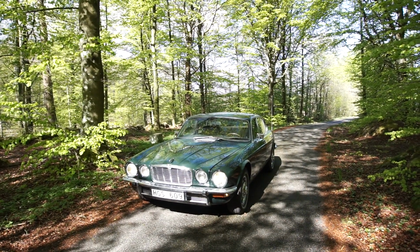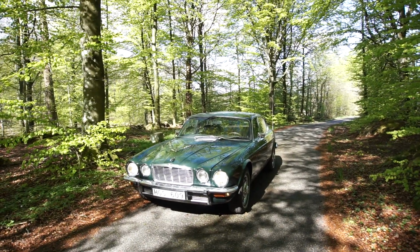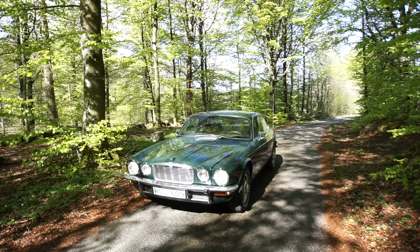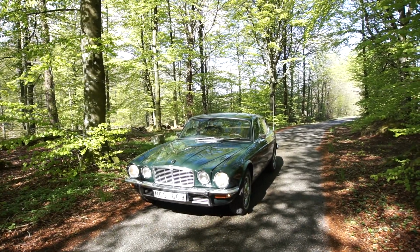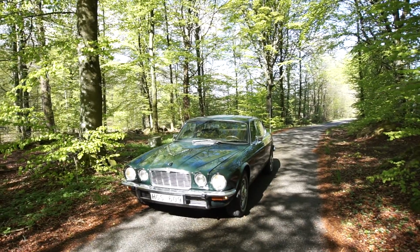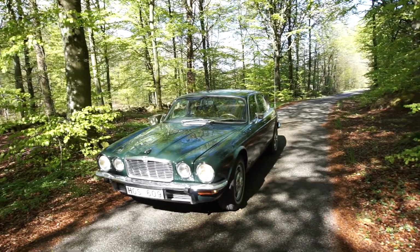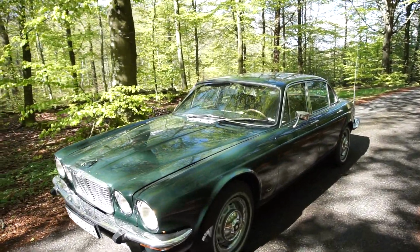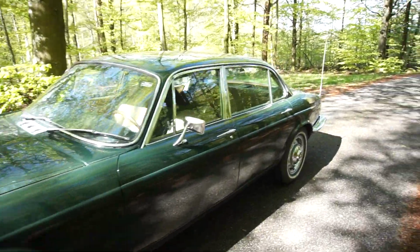So if you haven't been following along, this is my 1975 XJ6 that I bought in December of 2019 with a blown head gasket. Since about January 2020, I've been rebuilding this on my channel, just a home rebuild on a pretty tight budget. So I've had the head off, gone through all of that. Thankfully it wasn't warped. Did a resurface at home, reground all the valves at home and lapped them into place.